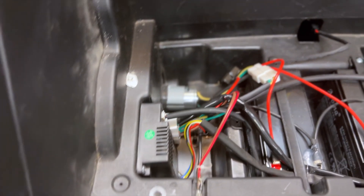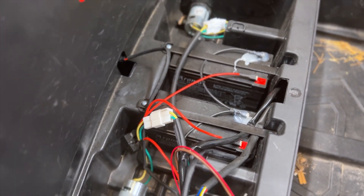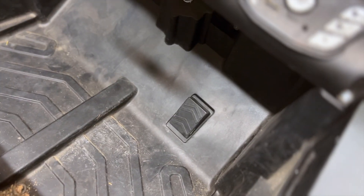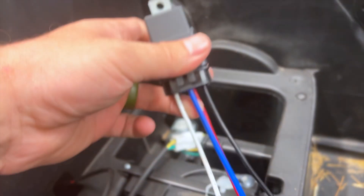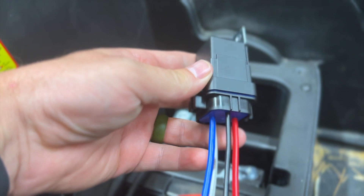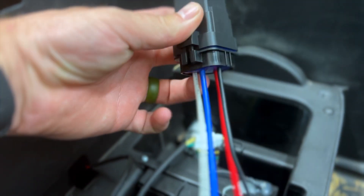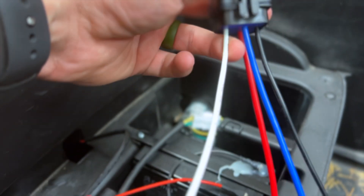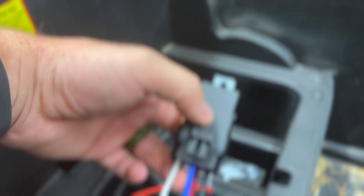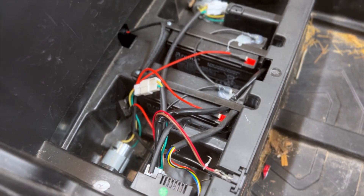I think this is the third time now, so we're gonna swap it over — put a new motorcycle battery in and just run it off a relay. I'm gonna simplify it using the pedal as a switch. I've got a waterproof relay, so essentially red will be power fused from the battery, blue will go to the motors, and then you've got your ground and your actual switch which will be the pedal.